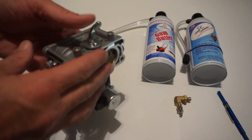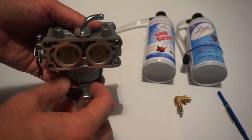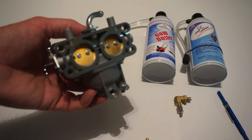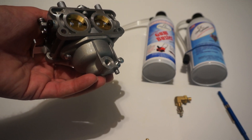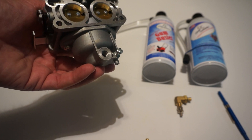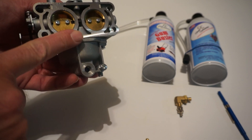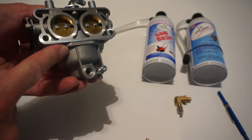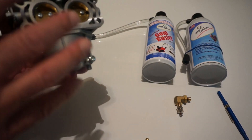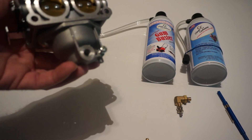At the end of the season, in order to not let the carburetor gum up again because of long storage, ethanol attracting water, and plugged jets — even if you use straight fuel it doesn't help much — the fuel dries out inside those very small holes inside the emulsion tube and even the main jet. Due to the phenomenon called the capillary effect, as you drain the fuel out of the carb, fuel stays in those very small holes of the jets, dries out, and that is what blocks the main fuel supply to the carburetor, leaving the engine unable to start because the air-fuel mixture is not rich enough.